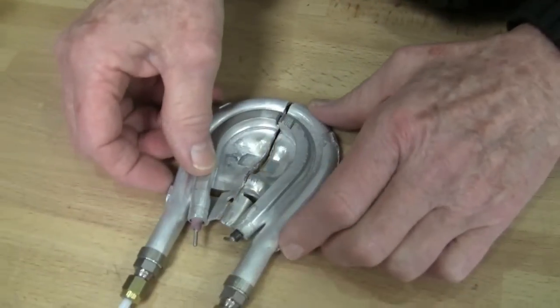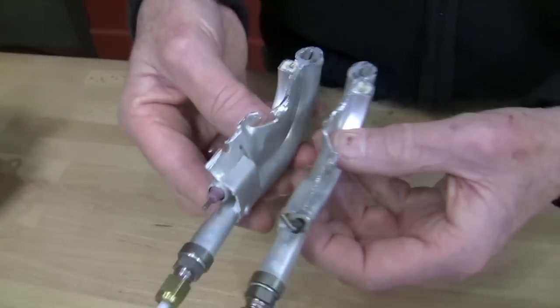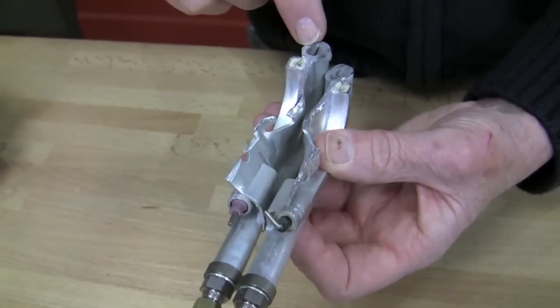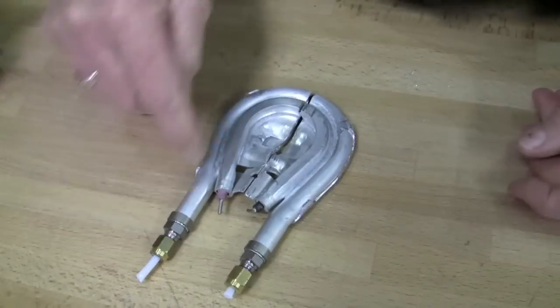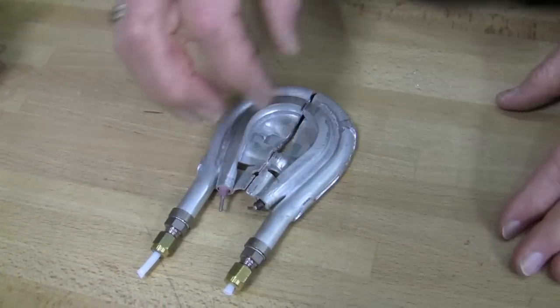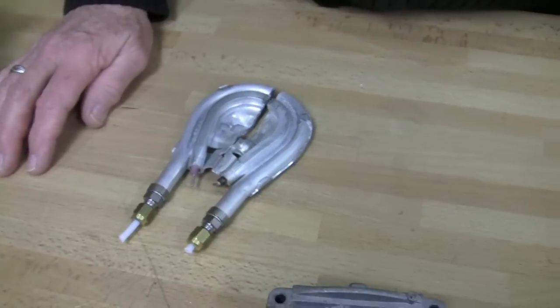On this particular one, this is the heating element - electricity in one side, out the other. This is where the water goes through this chamber, with the heating element right next to it. As the water goes in one end and out the other, it gathers heat - it's doing it on the fly, it does not store it. This is for the steam side. On the Serena, there is a small brew boiler chamber for the brew side. You see this commonly on super-autos as well, where you'll have a little brew boiler and then a rapid steam system.